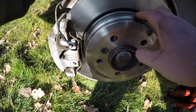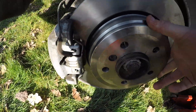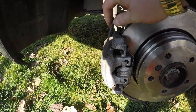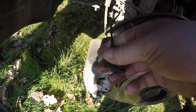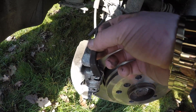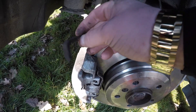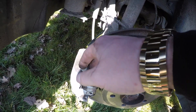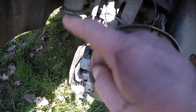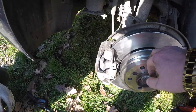As you can see, the new brake disc is back on, the caliper's back on, and the new pads are on. The handbrake has now been readjusted. Now we're going to hardwire the sensor, as the sensor broke — we're going to hardwire it so it doesn't trigger the brake warning light or any ABS lights. What you do is cut the connector off, hardwire the two wires together, and tuck it away. After this we're moving around to the other rear side, which I won't show as it's the same process.